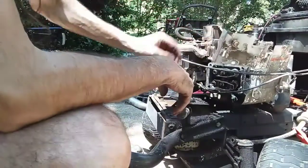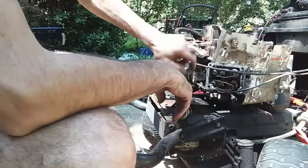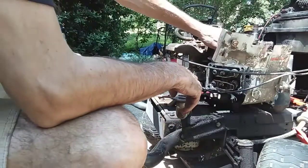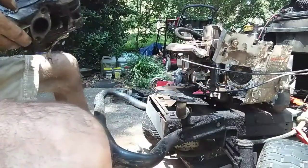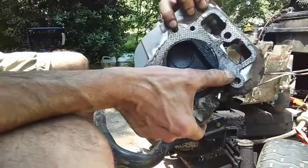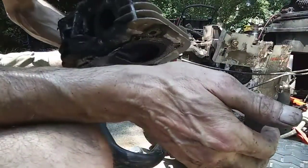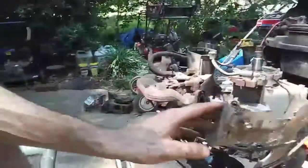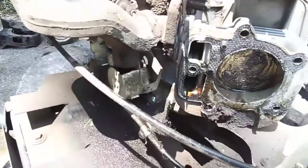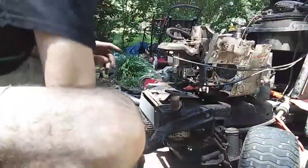All right guys, so we got the head loose. We had to take this tin loose and undo the intake manifold bolt over here. And there's 5 head bolts. They're all the same size. One of them's inside, and then there's 4 around the outside. So let's take it off. I'm just going to pull it on off now. Whoa. We'll check on the valves in just a minute, the valve seats. But look at that, yummy. Nice. Let's see if I can rotate that around.